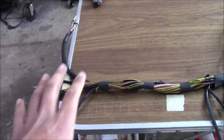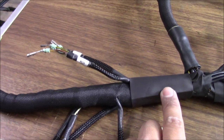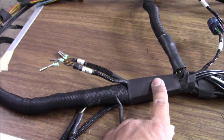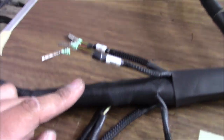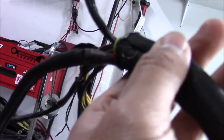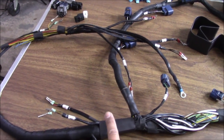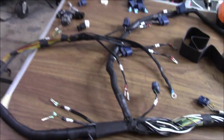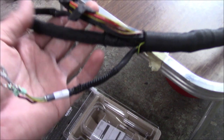This is what the beginning stages look like once you start sliding your shrink wrap. I slid the shrink wrap all the way to the end — this is a one-inch piece of shrink wrap that goes over all the connectors. Now I've got the half-inch split loom, and if you look close you can actually see where I gave it little slits so the wires can pull out. The rest of the split loom just wraps all around the rest of the stuff. That's why I really like this split loom — you just split it open, it coils really tight.